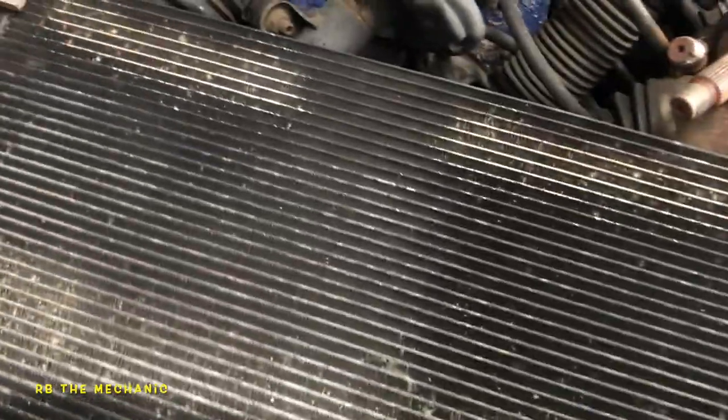There's our leak right there — that's how you find the leak. You won't see buildup anywhere else, only at the leak spots. Also check the lines and the pressure switch — it's dry there, no shining. That's where my leak is; it's going to need a new condenser. You also want to go down where the water drains are — there's a puddle of water there. You can shine the UV light on the water and you will see it. Shine down at the drain and you will find a leak.